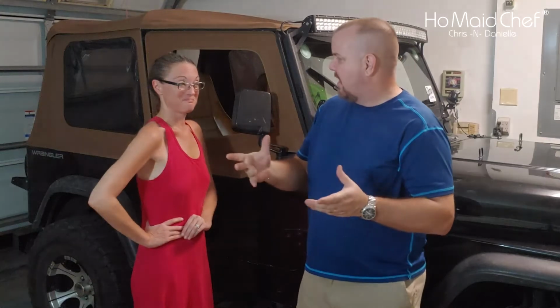Also picked up a fuel filter. We're going to change that in the next video, but y'all stay tuned for that. But right now, we're going to show you how we check this. On this Jeep, you need about 30 pounds of fuel pressure regulated, 40 pounds unregulated. So we'll show you how to do that in the video. It's going to be awesome.